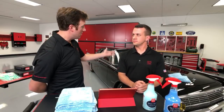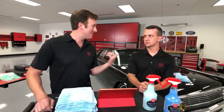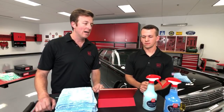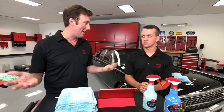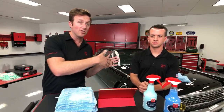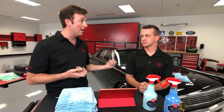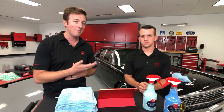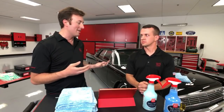Yeah. Again, this Lincoln behind us, it's a carbureted car. There's no exposed electronics. This doesn't see a lot of water to begin with, but I'm not going to actively apply pressurized water via a pressure washer or a hose. And again, it's going to be pretty easy to tell. Anything after 2000, I wouldn't shake a stick at. I'd go right after it. But if I'm diving into an older car where I'm really trying to do a deep clean, 100,000 miles, again, maybe carbureted, exposed fuel system, cold air intake, just avoid the places like Sam said. If water or air can get into them, it doesn't make a lot of sense to force water into their areas.